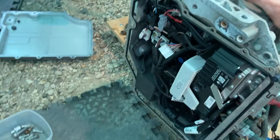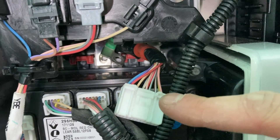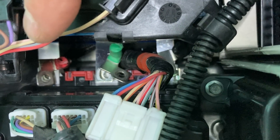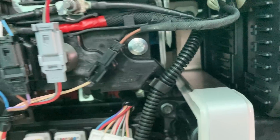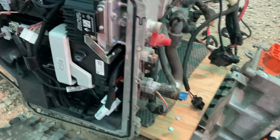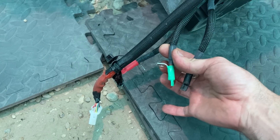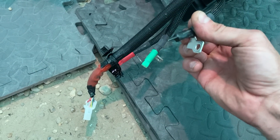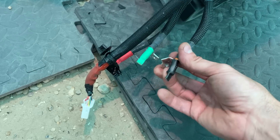In terms of actually doing the wires - disconnecting those - they bolt down onto the charging rectifier. This is the comms lead, and then you can see red, green, black. They go from the right hand side and then over like that. It is a pain, but that's the configuration they should be in. One tip: because particularly the black one is really tight when pushing them in, they're originally at a right angle - if you angle those slightly with two pairs of pliers, just being careful not to strip the insulation, that just makes it slightly not quite as big to go in, and then as you bolt it down it will just bend back.